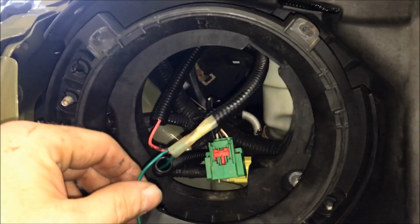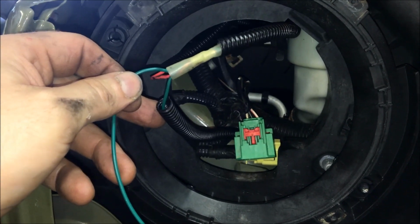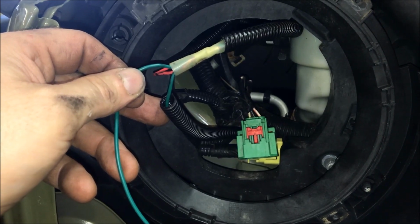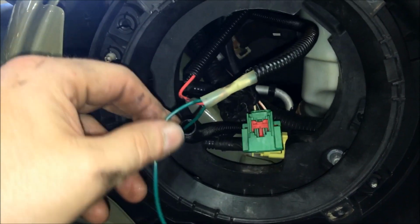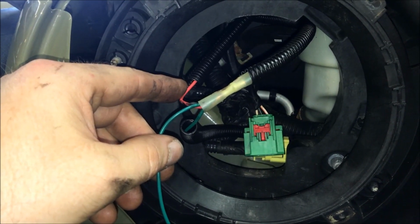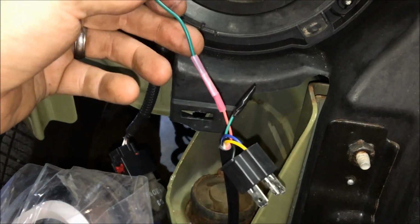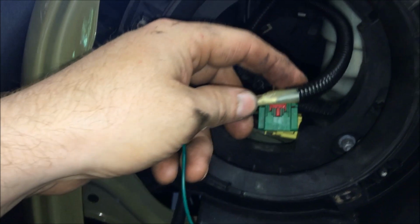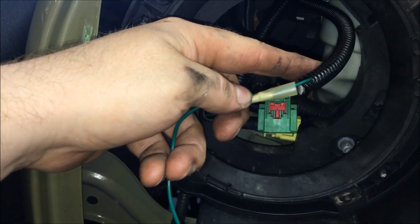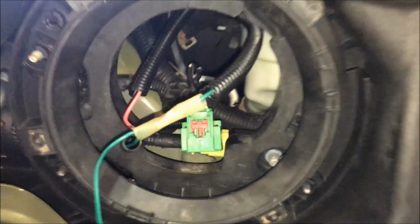And so back at the passenger side, this is where we're making all the connections. If you remember, we have the existing lead from the halos. That green wire right there is coming out from the bottom. There's the red wire coming from the driver's side, and then there's the other end of the butt connector going to that headlight to join that one together. And on the opposite side is the actual 12 volt power source, right? That's going to the power tap and the fuse box. So essentially that is running right there.